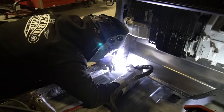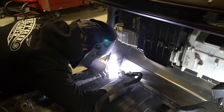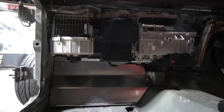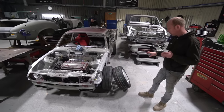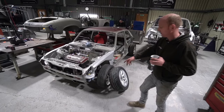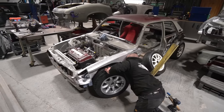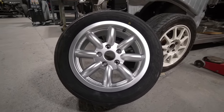Bobby's also finished the mountings in the footwells for the twin PDUs and the ECU. We're using two ECU Master 16-channel PDUs and one ECU Master engine ECU. The twin PDUs are both CAN-linked so they're controlled through the CAN network on the car. He's got those mounted in the footwell and built a kick plate cover which will cover them up, keep them out of harm's way, and also form the footrest underneath the carpet in the passenger footwell. He's also done a final fitment wheel check — clearance on the washer and screen wash tank is about 35mm so plenty enough.